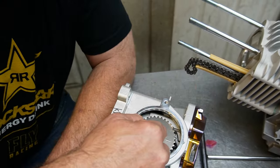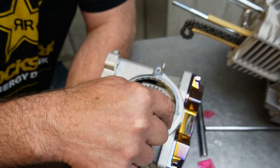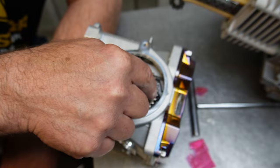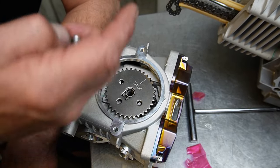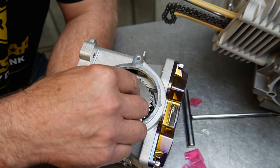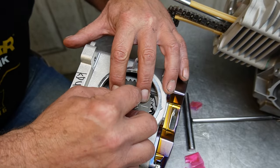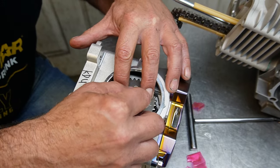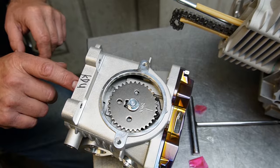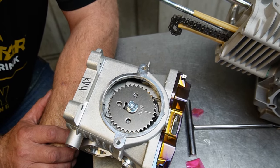So I would imagine that top dead center is straight up and down. Because that's basically, you can see we're about like 2 o'clock right there. The same amount on the other side, which would be like 10 o'clock. I would assume that this guy goes down. Holds that into place, and I really can't put this together till I get it there, because I gotta weave the chain up, bring it up through the sprocket, and get this all lined up top dead center.